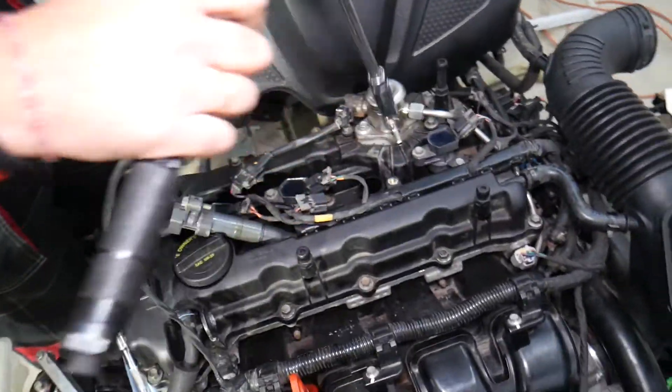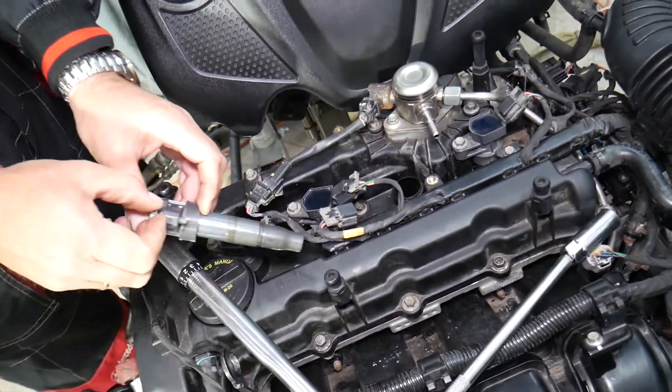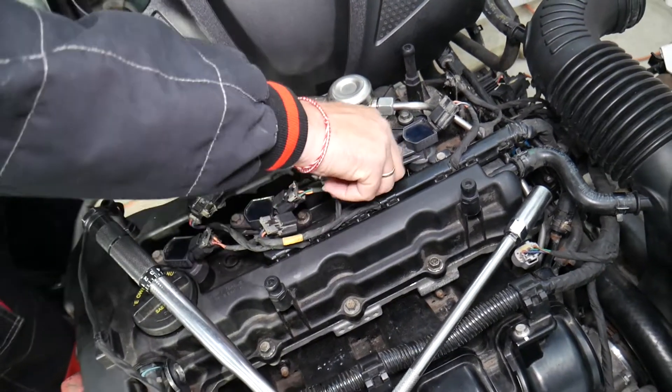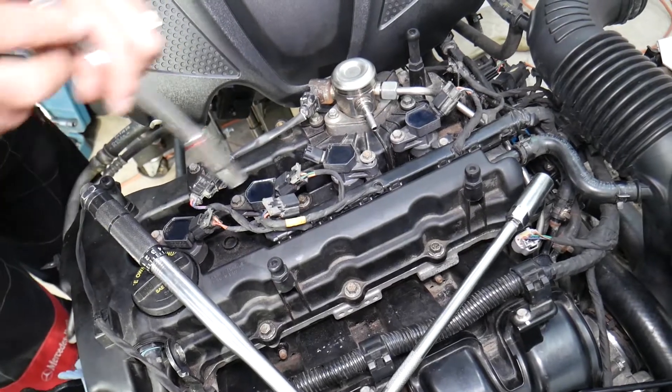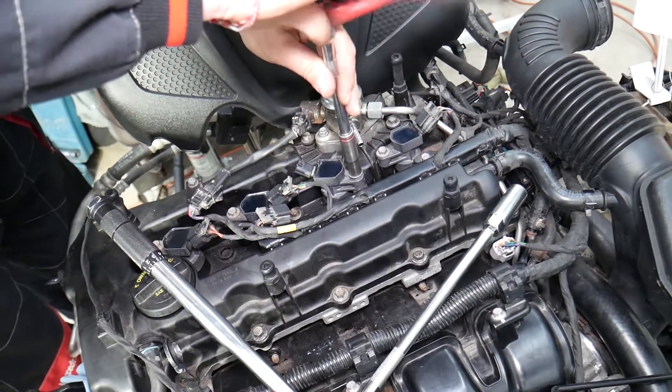Right there — and you stop. Next step, go ahead and install your ignition coil, push it in, and install the bolt. It's important to connect the connector correctly, otherwise you can develop misfires as well.